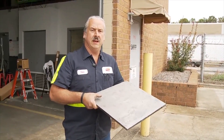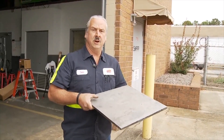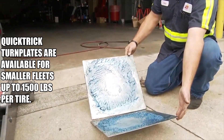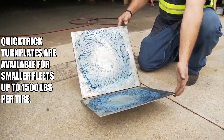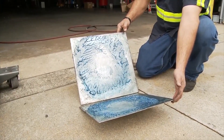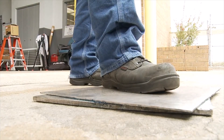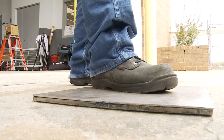After we've checked the air pressure and got the steering wheel locked and the parking brake set, we're going to put the front end on these turn plates. I made these turn plates out of some sheets of aluminum and simply put grease in between them. From time to time the grease will squash out and you've got to add grease to it. But it keeps the suspension at an at-rest position on any ground you may be working on, whether it be concrete, blacktop, or any smooth surface.